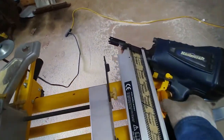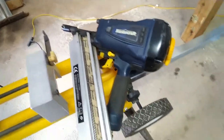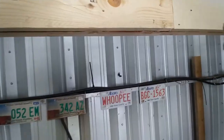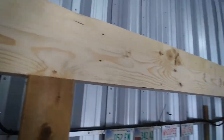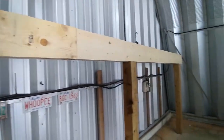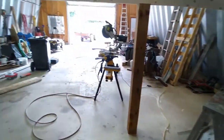Yeah, then if you're going to do some of this stuff, you want to have something like this guy here. You got your automatic hammer, and it fills up full of nails there, and then powered by air, it certainly saves a lot of wear and tear in your arm, because those things there take a lot of nails. I put nails in, like one there, one there, one there, one there, one there, one there. Okay, I can count them. 1, 2, 3, up to 18, 22 nails for a 12 foot thing. So that's a nail every foot twice. And that's a lot of nailing, because you do that side and then you do this side and then you do the other side. Boy, it's three times as many. So one of those things there is pretty handy.